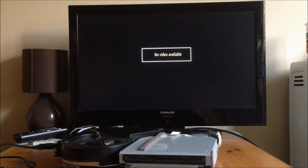I don't want to get into it too much right now, but I always recommend, once you've flashed a PS3, to downgrade it to 3.55. Then you can toggle QA, which is a permanent effect on the PlayStation, and then that's lasting then, so you only have to toggle a PS3 once in its lifetime and it's done. And obviously at the moment you can only run toggle QA on 3.55.